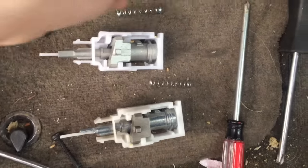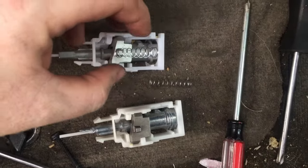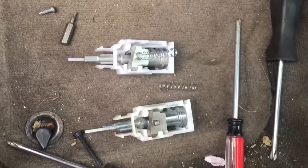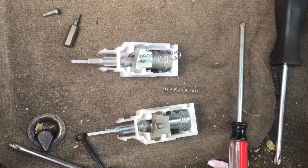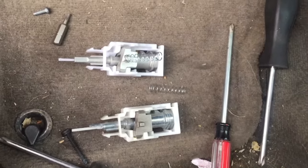The new one does come with this extra spring. The spring sits here, and on our shift cable interlock, see this round indent — that's where the spring sits. So if you're wondering, when you took it apart, about this little spring that seems to fall out and you don't know where it goes, that's what it is. I guess they give you a spare because there's a decent chance you'll lose it.